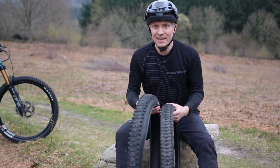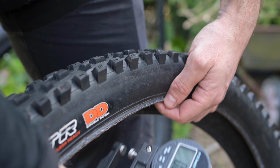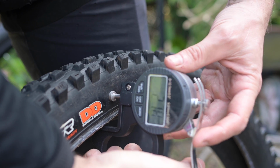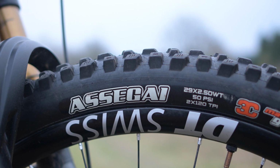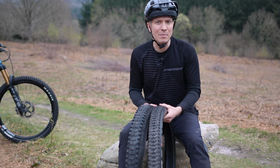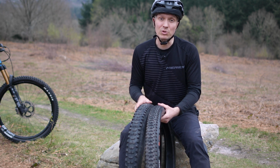Of course, once again, there's a trade-off, and that's that tyres that have multiple plies of thicker threads are much tougher and better at preventing punctures and cuts, even when you run them at low pressures. Of course, the casing also has a large impact on the weight, and heavy tyres do take more effort to accelerate up to speed, again sapping a bit of energy. Tyre volume also factors in here too. A larger volume tyre will be heavier for the same type of casing, though interestingly enough there's some evidence out there that a higher volume mountain bike tyre can actually have a lower rolling resistance.